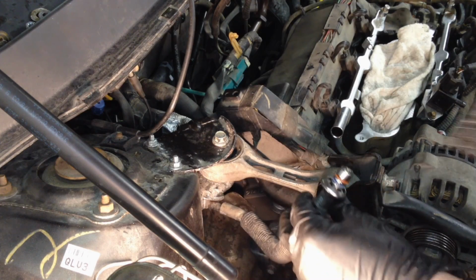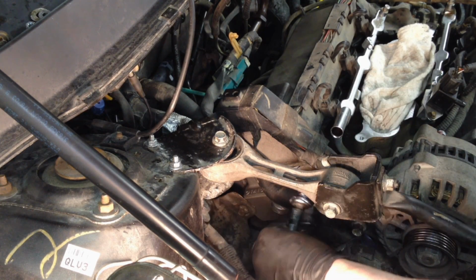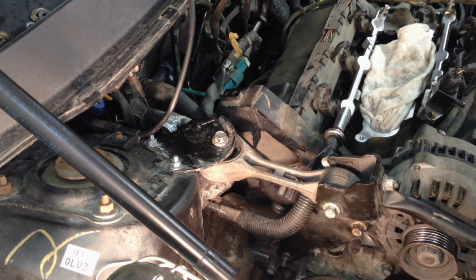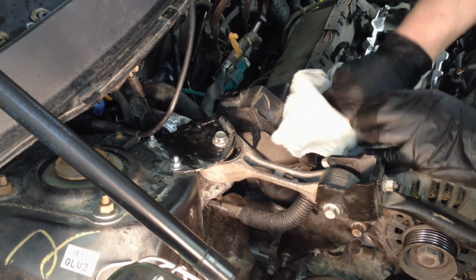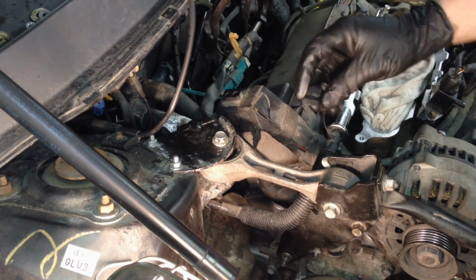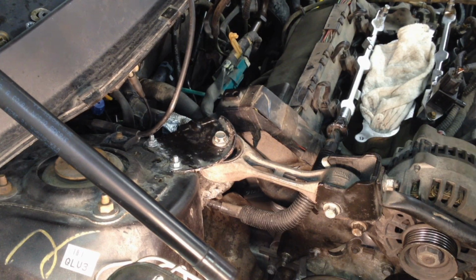Let's get this fuel connector on. I put a little bit of grease on here. Just a little bit. Help it on. They get dry. And then we'll snap it until it clicks. And you can't get it off. And don't forget your safety catch. We're getting there, guys. We're getting there.